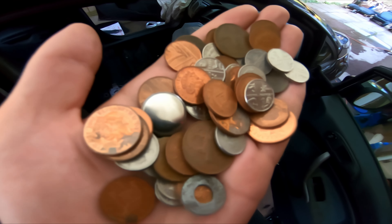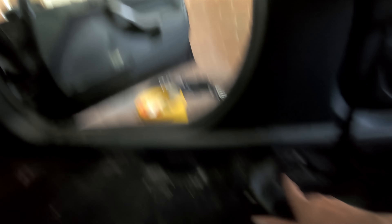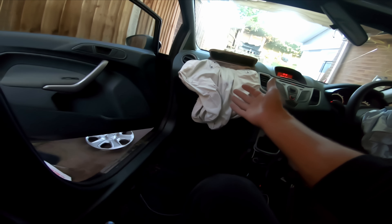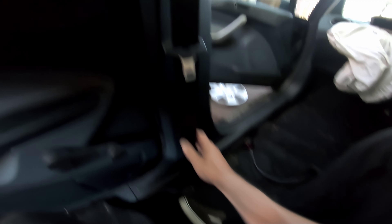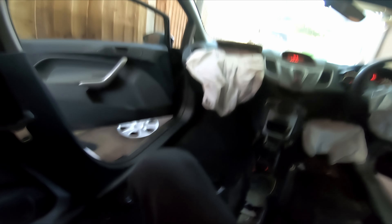We've got around about 56p, a washer, and a battery — which makes sense why the car key remote doesn't work. The next thing to get the carpet out is take this seatbelt bracket off. When you're in an accident, the airbags go off but also your seatbelt has a little shotgun cartridge at the back end near the bottom — it explodes and tightens your seatbelt to guarantee you're sucked into your seat. With this one we're probably going to have to cut this seatbelt — look at it, it's like a guitar string, it's proper tight.